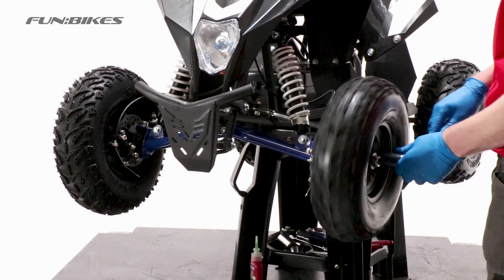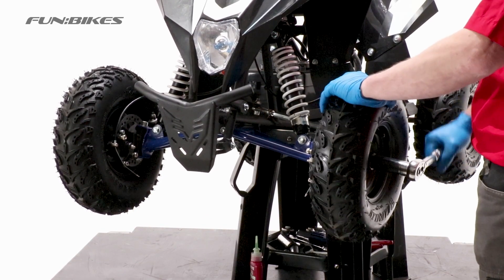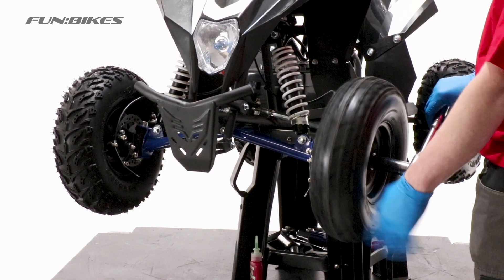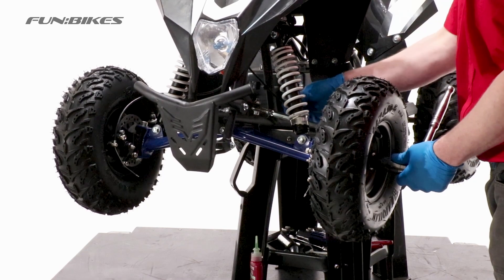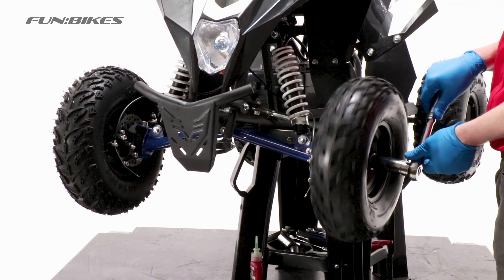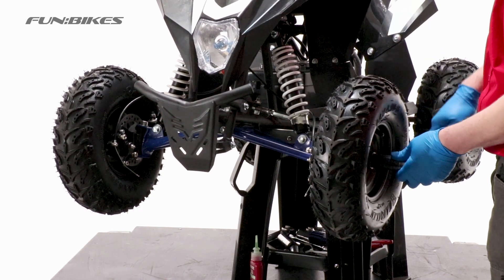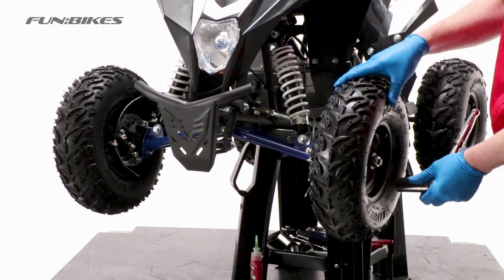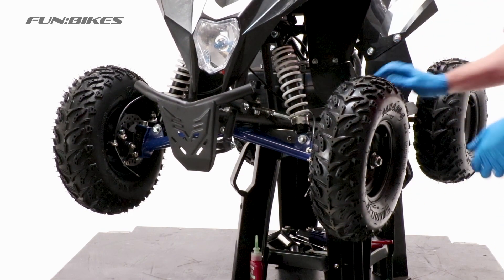Now I am going to make sure our front wheels are tight. Make sure there is no side to side play in the wheel at the top and bottom but that the wheel is not over tightened. If we over tighten the wheel it will cause it not to spin freely, the bearings will overheat on the quad and eventually fail. Once we are happy with the tension, apply some stud lock at the end of the threads and repeat the process on the opposite side.